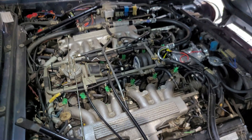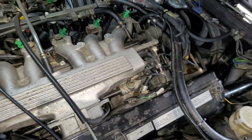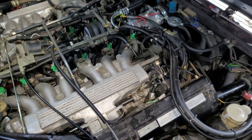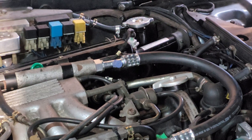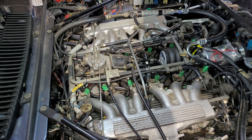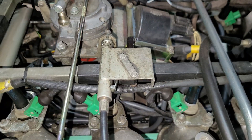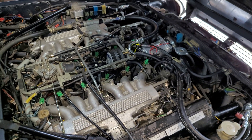I think that covers the sensors on the engine. The main ones are mainly temperature-related: you've got temperature switches here, temperature measurement probes and gauge probes in the coolant rail, and temperature measurement of the air and water on that side of the engine. Switch-wise, it's mainly to do with throttle operation: the off-idle switch at the back and the kickdown switch in the middle.